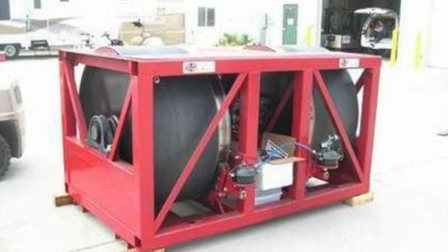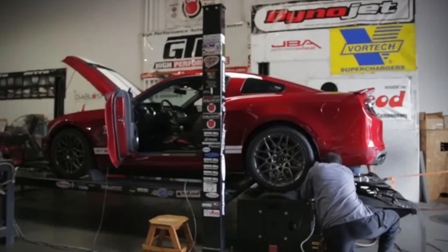On hub dynos you can even run a quarter mile simulation and shift the car, which is really cool. A chassis dyno tests the whole vehicle. Most chassis dynos are inertia-based — it's a calculation based on the inertia of the big wheel the tire rolls on. It calculates how much torque it took to accelerate that inertia, measuring both the rate of acceleration and the miles per hour from the velocity of the wheel.